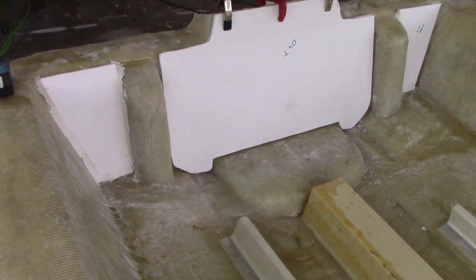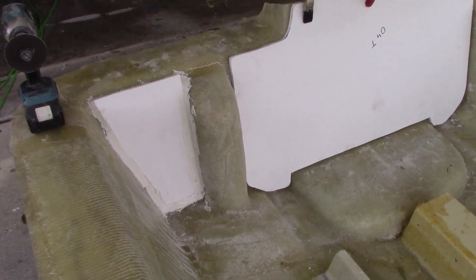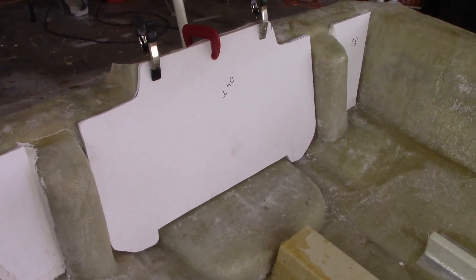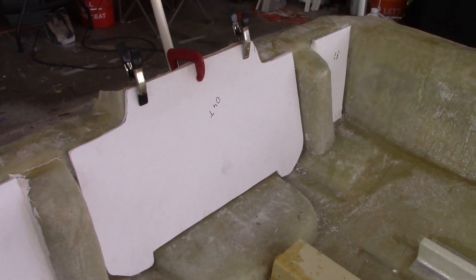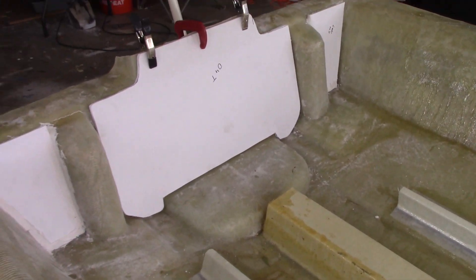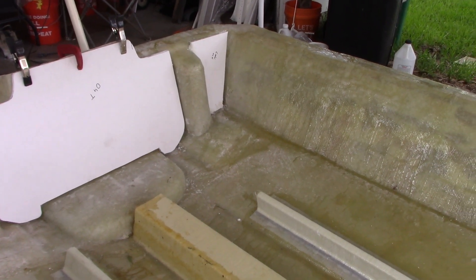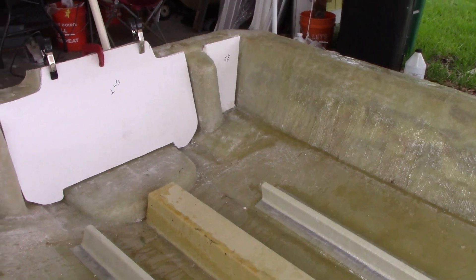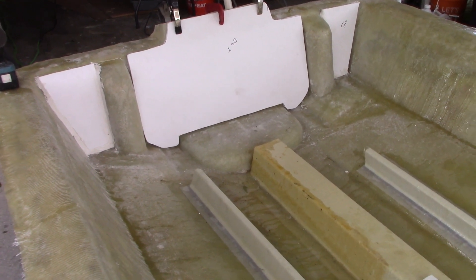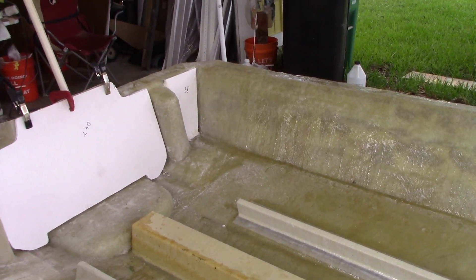What I just did is get the back of the boat done — the transom. It's basically a PVC-type material so I just glued it in there. You get a lot of things that are gonna have to bolt through the back of the boat, and obviously the transom has got to hold all the torque of the engine. So I'm gonna double up on the back of the transom — it's gonna get another piece just like that. It's a super strong epoxy-type glue or caulk that I'm using there.